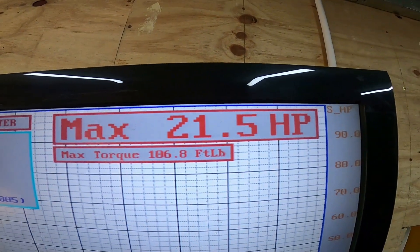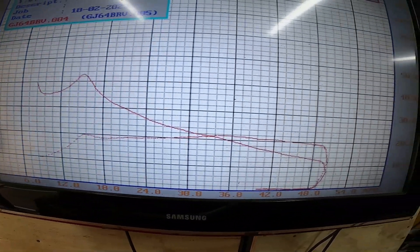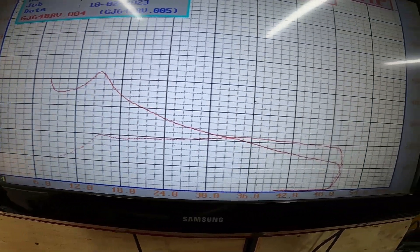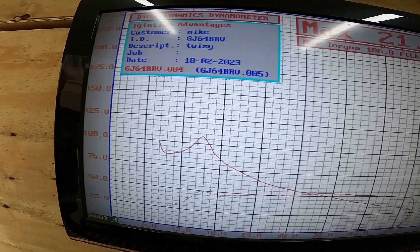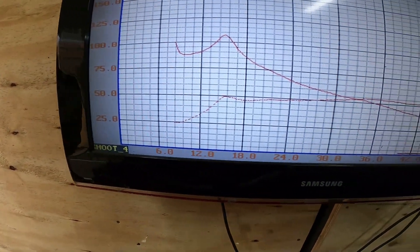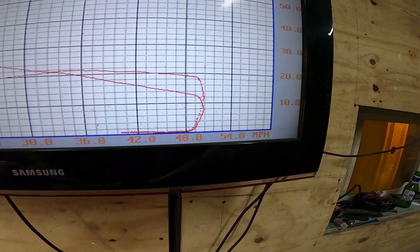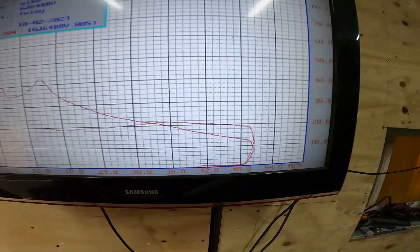Pretty accurate: 21 horsepower, 106 foot-pound of torque. It's the weirdest power graph I've ever seen — consistent 21 horsepower and a big spike of about 100 foot-pounds of torque, then it slowly drops off higher in the speed range. I'm measuring it against road speed, so obviously the speed limit kicks in at about 49-50 miles an hour. How weird. Right, let's tune it.